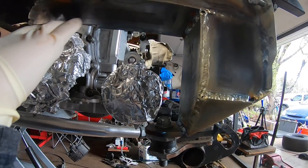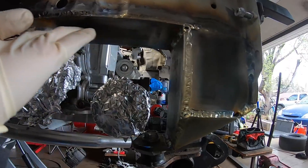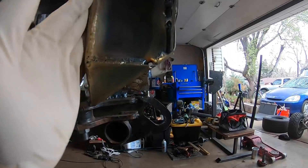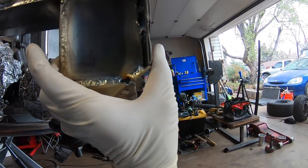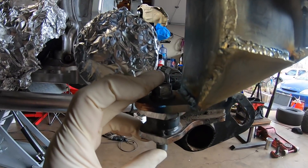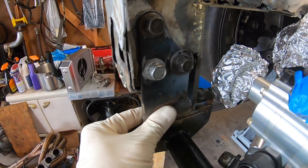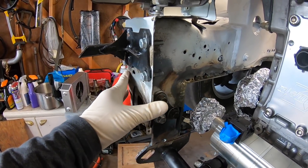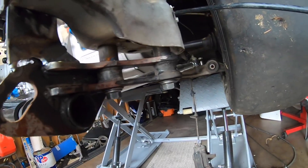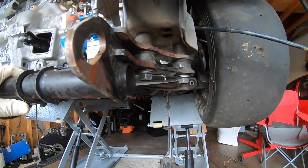I welded a three-inch quarter-inch thick steel plate underneath the frame that's been cut in half, and also another plate to make a small frame section connecting with the traction bar. There's a big 17mm bolt there, and the traction bar connects with another plate using three bolts on the original frame. I think that's strong enough. The other side I didn't have to cut, because I used the original two bolts underneath for the stock traction bar.